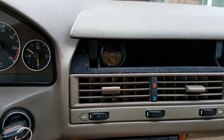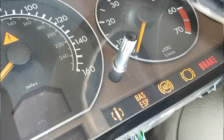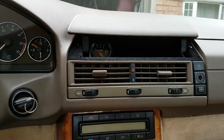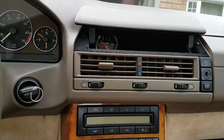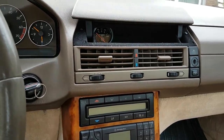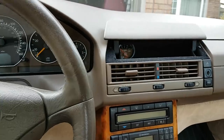This video is about the oil pressure gauge install on my SL500. I also installed an oil warning light so that if the pressure happens to go low there's going to be a warning light on the instrument cluster. This is a modification I really recommend for everyone with these cars because none of these cars actually come with oil pressure sensors anymore, so if your oil pressure goes low you'll basically blow your engine with no warning. I learned that the hard way when I blew my engine on the 55.